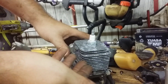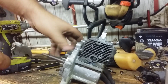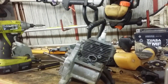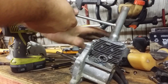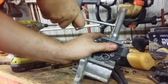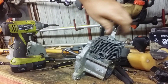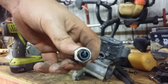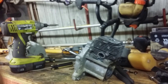So now we're down to our cylinder head, spark plug, crankcase, and flywheel — but I'm not pulling that off, it's way too rusty. We'll pull the spark plug off. This tool is for a chainsaw, so don't worry if you don't have one — it usually comes with a chainsaw. Put your spark plug loose. That one is nasty. All that oil in there means that plug wouldn't fire like it was supposed to.